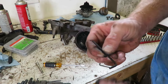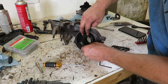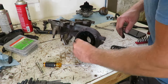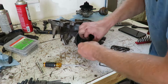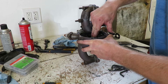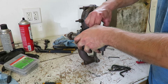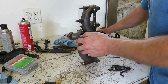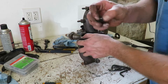I took a closer look and they're actually Allen bolts - everyone online said they're supposed to be Torx, so I'm not sure what's going on there. Once you have those bolts out, pull this whole assembly straight up. And these are the spacers - there are three of them on each bolt.